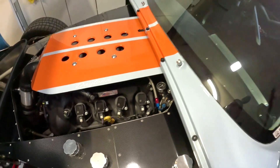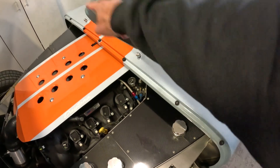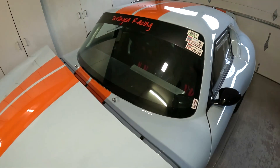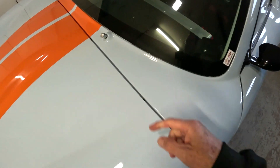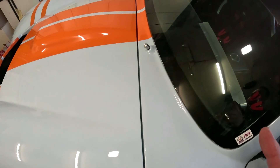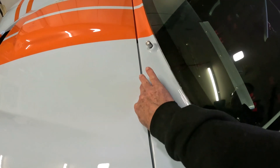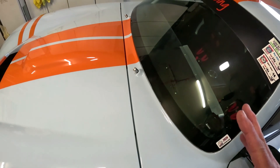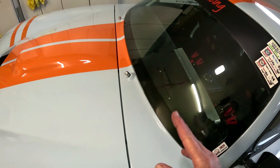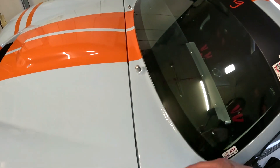The one thing that I do know that mine's different from Dave's — I'm running the little bump stops here all the way around, so I've got a pretty good gap between the edge of the hood. You can see there's a lot of potential for airflow back in there. I've done a yarn test on this car when I was doing aerodynamics in a previous video, and you can see the yarn I put here gets sucked down into there. So this car actually has a really low pressure system inside the engine compartment. But in front of the windshield, this area is all very high pressure, so it's probably jamming the air down in there.